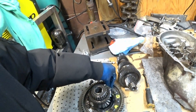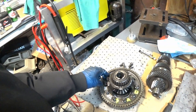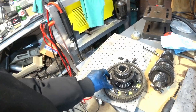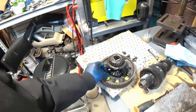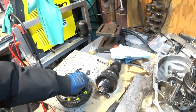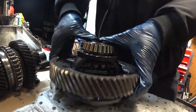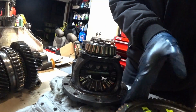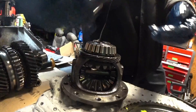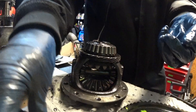I'm taking off the final drive gear, but you gotta remember these are reverse threads - so you actually have to set the gun to tighten in order to loosen these. I'm hoping I can just hit it with a little hammer and it'll come off. They just came out with no problem - so that's a good sign. This work is done; I'm just gonna tighten these back up and throw the whole diff back into the transmission.